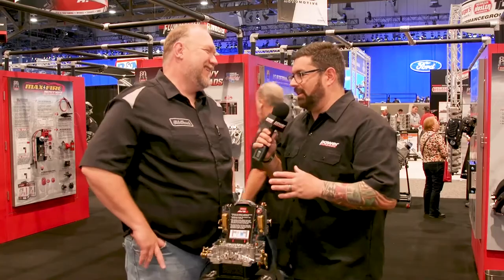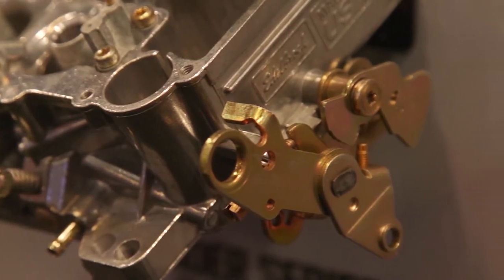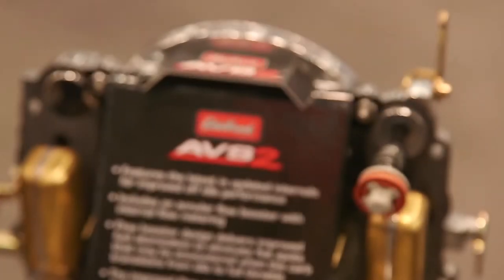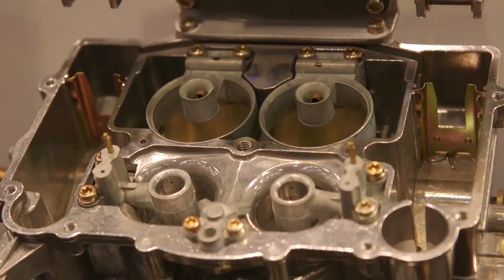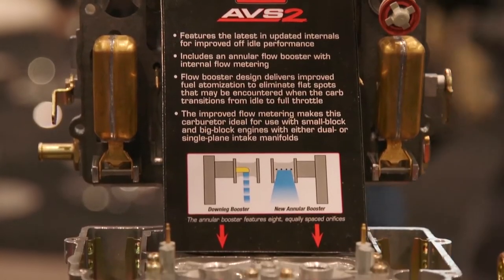You and I love the simplicity of the carburetor — there's something of pure art and almost a joy to tuning that carburetor correctly. But you guys have made it where now low-end power, low-end drivability, and throttle response are approaching fuel injection style. Very close to it. For a carburetor, the Performer has always been a great street carburetor, very easy to tune, very easy to drive. It still has all those features, but with the annular discharge booster, there's even more bottom-end torque and more throttle response — everything's a lot better in that bottom to mid-range. And it still has your air-adjustable air valve secondary door, just like the Thunder Series is known for. We've taken a good carburetor and made it great.